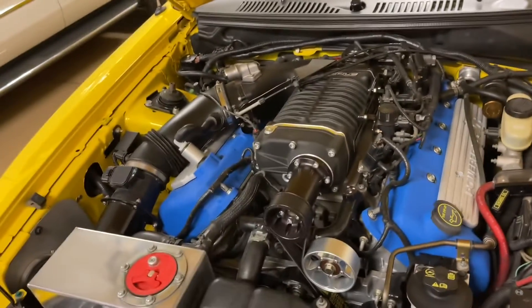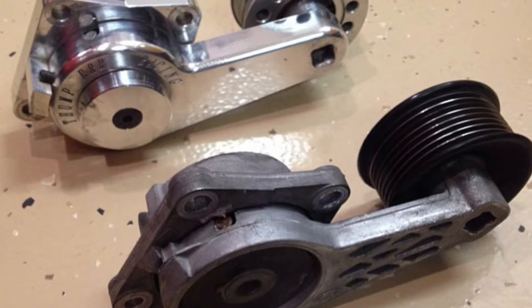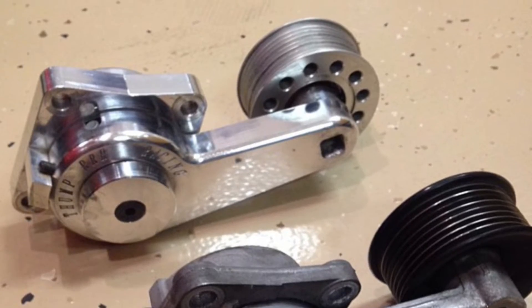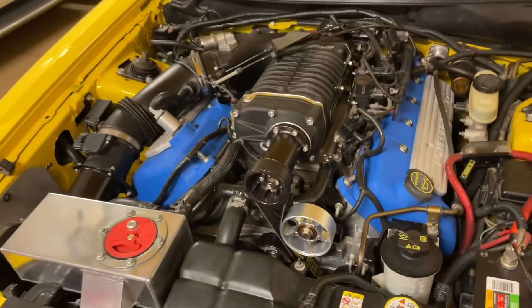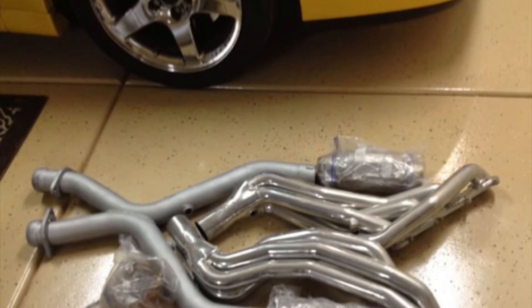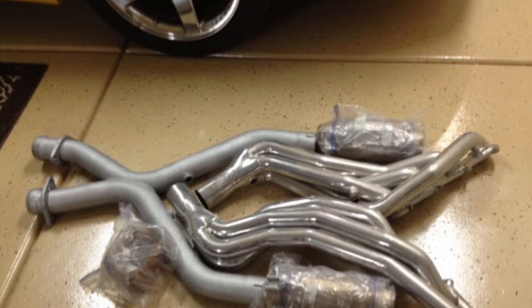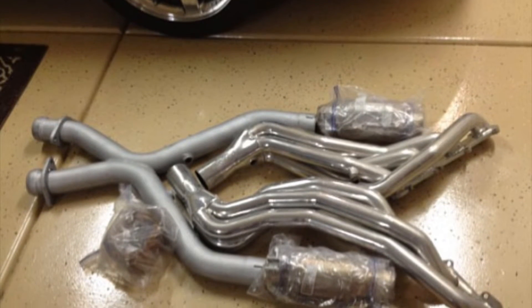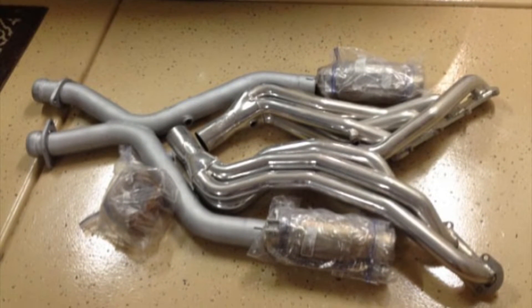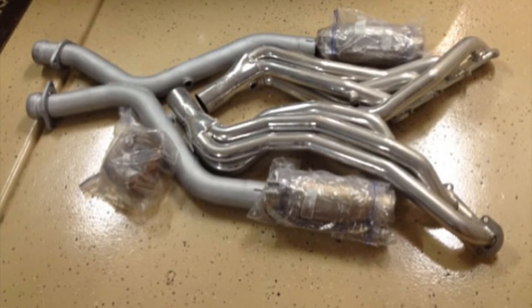You can change pulley combinations. You can deal with belt slip, tensioner problems, and alignment problems. There's just so much you don't need to deal with by going to the more efficient, smaller blowers that are now available. If you're starting at 28 PSI with a 3.5-inch upper and a stock lower, you're going to have to go to headers and cams and all kinds of things just to bring the PSI level down so it's tunable for regular fuel. Even with headers and heads and cams, you're probably only going to bring it down from 28 to about 25 PSI, which is still very difficult to tune with. That's too much boost for regular pump gas.